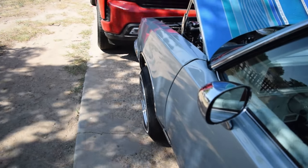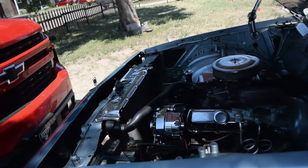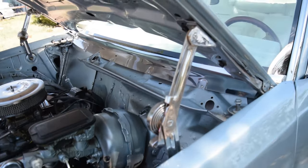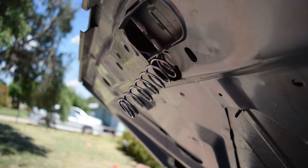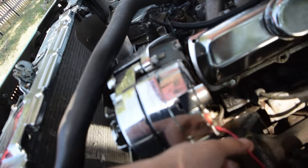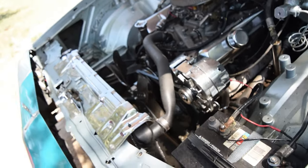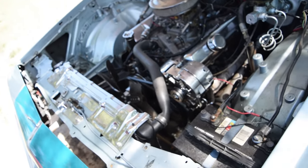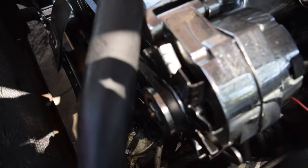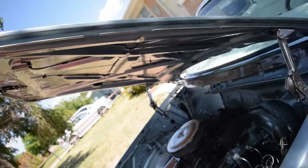When fully locked up I feel like it has a little bit of negative camber - I'm not the biggest fan of that. It's got polished hinges and a polished spring - some fanciness. With all the oil around, I also don't think the alternator is charging properly. It only has one power wire running to the positive - it might need a signal wire to tell it to run. The belt could also be slipping due to the oil. The battery was reading 12.5 volts and with the car on it was 12.9, which still isn't great.